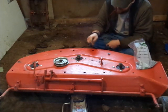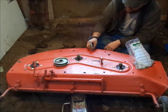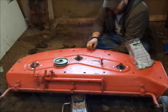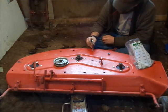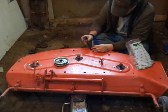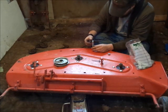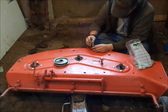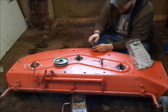I also bought carriage bolts for in here — should make sure it's perfect. These should be long enough. I figured I'd take a second and show you guys the bottom of this. I did tighten these down — these are three-eighths by two inch carriage bolts. As you can see, they're probably about right. There is a lot of thread sticking out, but it's not excessive. If it was out much more I would say you have to cut it off, but the way they are now is okay.